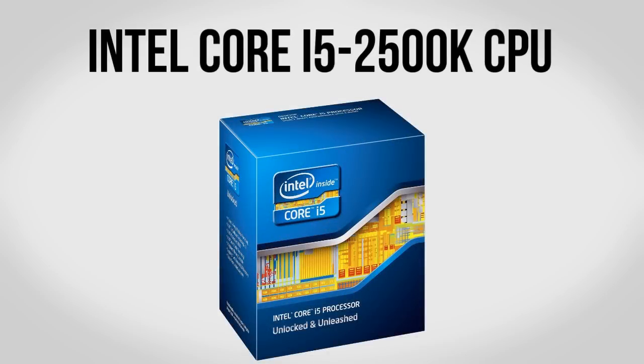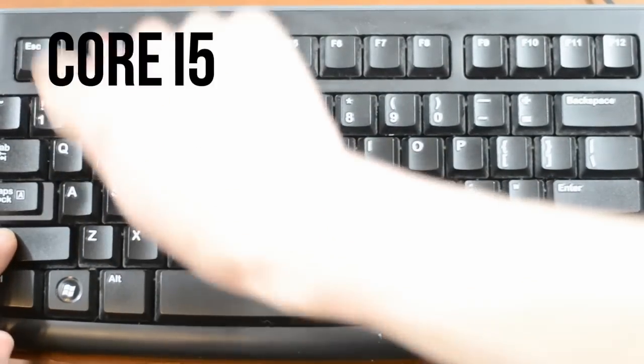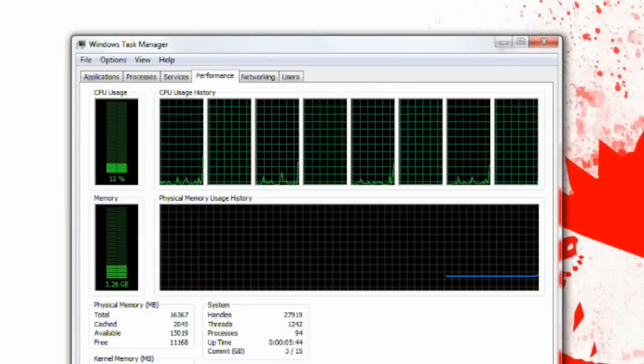To start our build off we'll be using an Intel Core i5 2500k CPU. Now you're probably wondering why not the Core i7. The major difference is that the i7 has hyperthreading, which allows Windows to see it as 8 cores as opposed to 4. While that's great for heavily threaded tasks like video editing, for games most of the time they struggle to use up 4 cores, so those 8 virtual cores really aren't going to give you a lot of performance benefit. Beyond that it's very similar to the i7 — you'll still be able to overclock it well over 4GHz, and it's a rock solid CPU for gaming and day-to-day use.